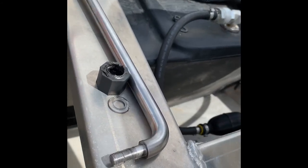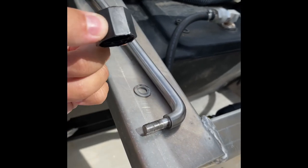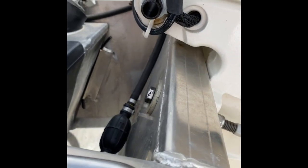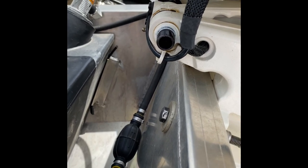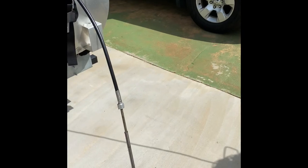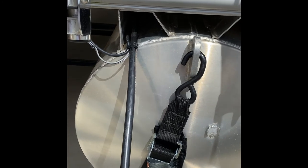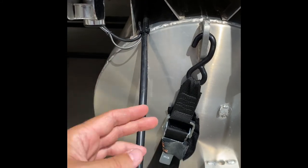Here's the arm that attached it, and on one side it's kind of like a nut but it's rubber — I guess it acts as a seal. But it was only finger tight. I didn't have to use any pliers or anything to take it out, so maybe that's the whole issue. Anyway, there's the steering cable hanging out of the back side, and next I'm going to disconnect it at the steering column and pull it through.